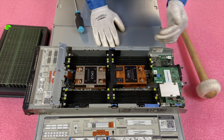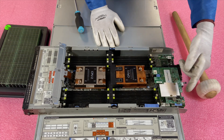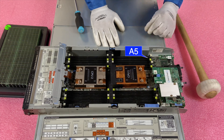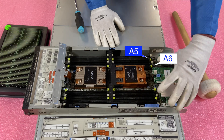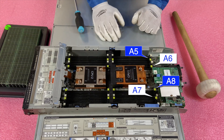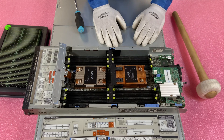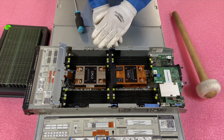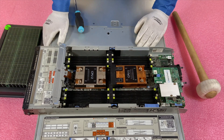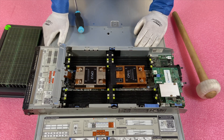If you're putting in 16 DIMM slots, after you go through the first four white slots, you come back to the blacks: A5, A6, A7, A8. Then on CPU 2 you'd fill up all the white and all the black. The greens will all be empty, and you've now put two DIMMs in each of your memory channels, keeping a nice even distribution. That's something we actually apply to how we sell memory on our website — we sell them in kits that keep them even per your channels.